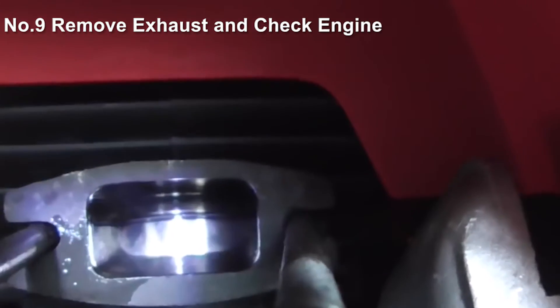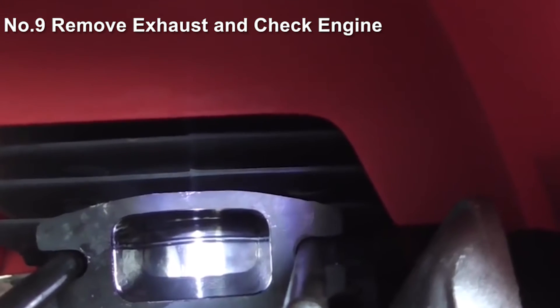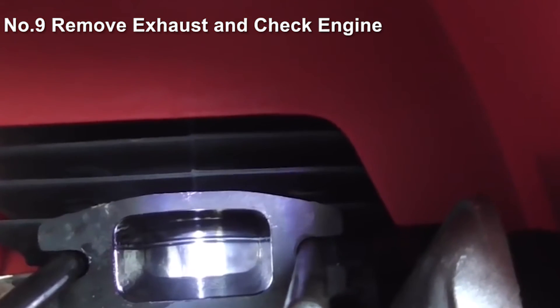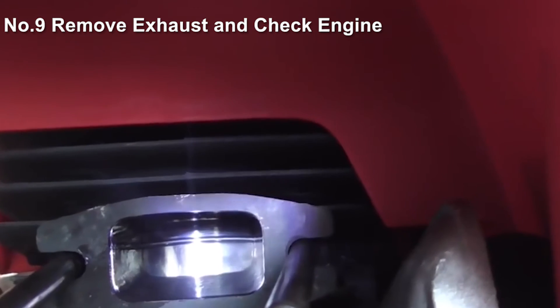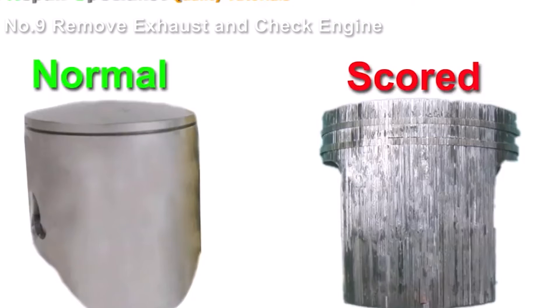Taking a closer look at the piston and inside the engine, we can see the piston itself looks like it's in a good state of repair. There are no major score marks or evidence of wearing and overheating. But if there is any evidence of damage inside here, it needs to go to a repair centre — it's far more than what can be done at home. Sometimes the cost of doing so can be worth more than the machine itself. To make things clearer, here is a normal good piston with no damage, and to the right is a scored one — you can see the lines going down where there's been metal transfer between the piston and the barrel because it got too hot. This is completely damaged and the engine will not run like this. There is a level of scoring much less than this which would still result in the engine not starting.